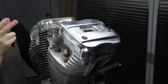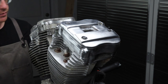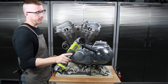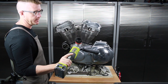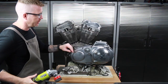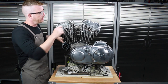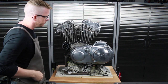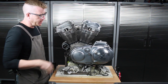You can see the difference between these two jugs, these two heads and rocker covers — it really is starting to shine up nice. The best way to get this done is with a wire wheel. It's pretty aggressive, you have to be careful, but it spins fast and will remove quite a bit of the layers of whatever this is — I think it's clear coat, not 100% sure, but it's flaking off big time. The engine's been run hard for the last 28 years and has a lot of miles on it, so it's time to clean it up.